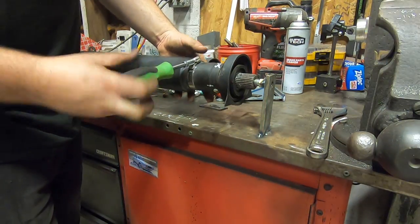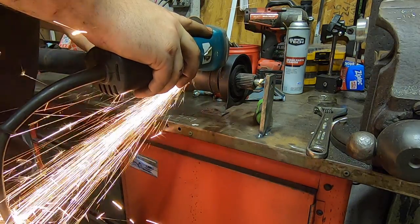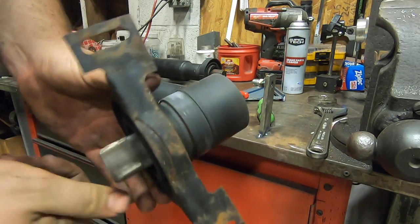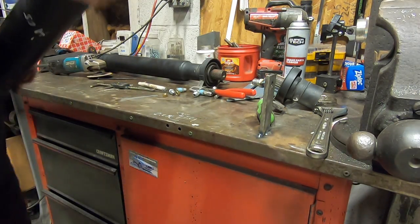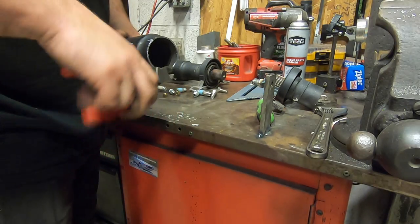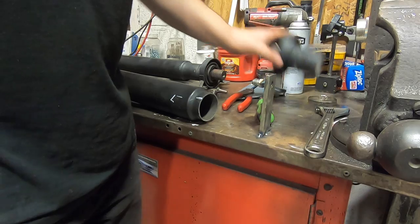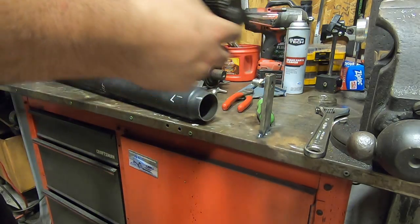Letting the grinding wheel just rest along the side of the clamp to guide it does a really nice job. There we are — we've removed the part of the shaft that does not fit my car and we've got a fairly straight edge on it. Keep in mind this doesn't have to be perfect — that's why I'm going to be tacking and truing the shaft before welding it. But the closer I get it now, the less work I've got to do later. I'm going to repeat the same process on the other shaft and then snap it back in the fixture.